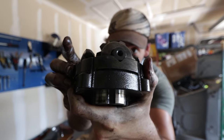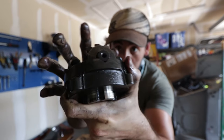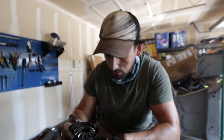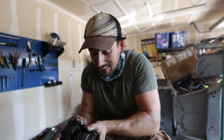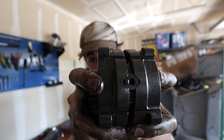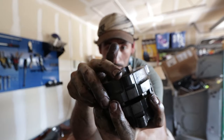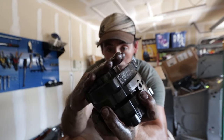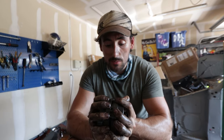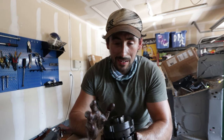When this thing sets in here it's going to have these little triangles cut out — the gears ride on those triangles. Normally when it's open it just spins, but when it grabs it wants to roll out of the groove. When the friction pushes up against this and causes it to want to roll out, that's what causes it to open or close. This is technically a two-way diff — on decel or accel it'll open up in two different directions, and the springs and clutch discs push up against this to hold it all together.